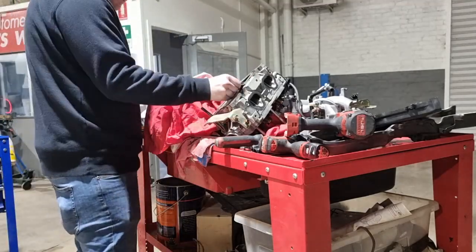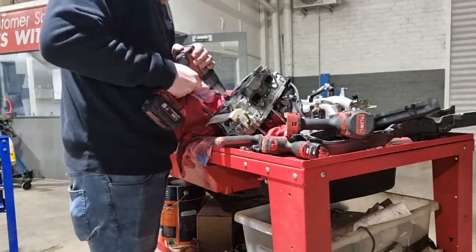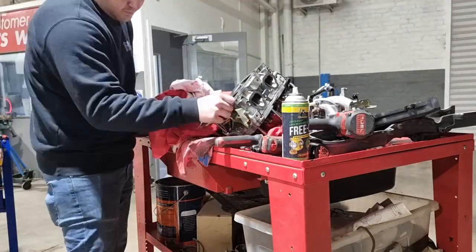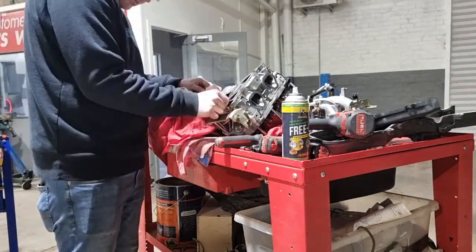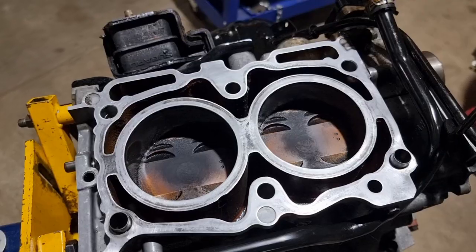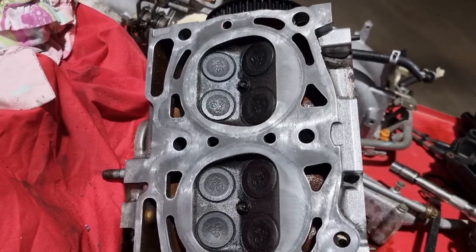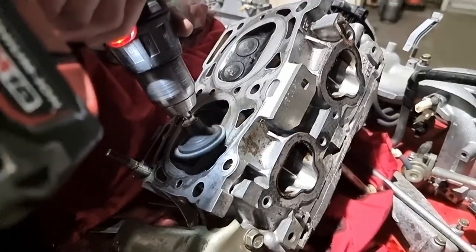You're probably thinking: why didn't I machine the aluminium heads? As you can see in one of these clips, I put a straight edge across it and checked the run-out on the head to see how warped it is. This is done by using a straight edge and putting a feeler gauge underneath to see if it's still within spec. The heads on this were not warped at all, and therefore I did not worry about getting them machined — also, cost and time, and we cannot do it locally in our town.